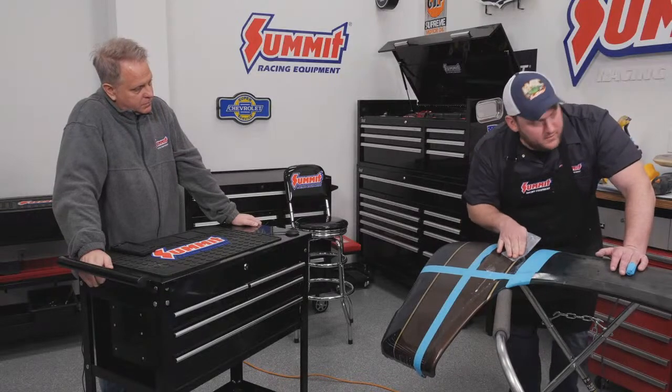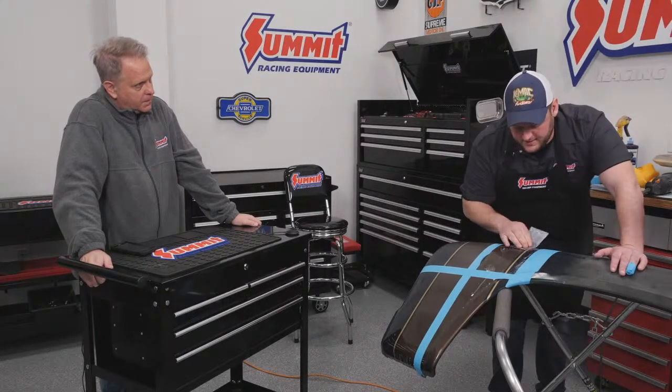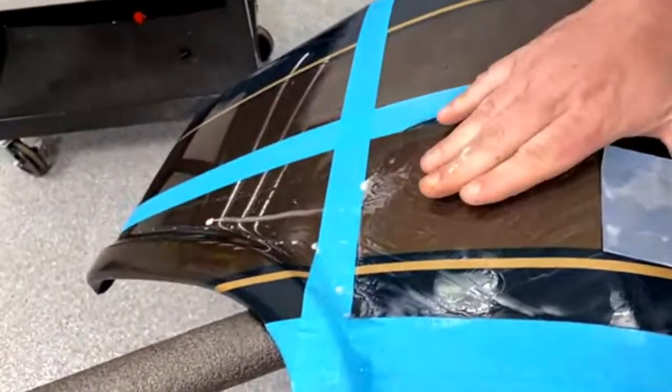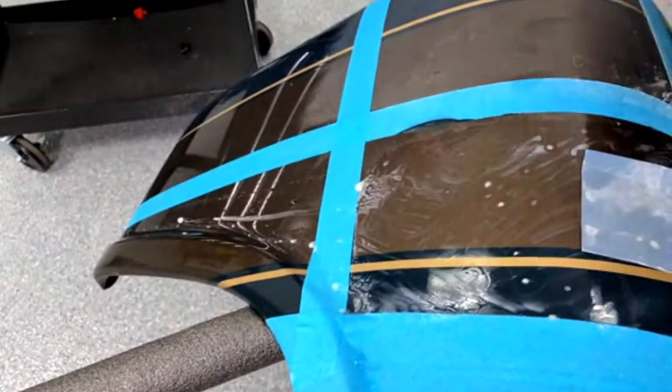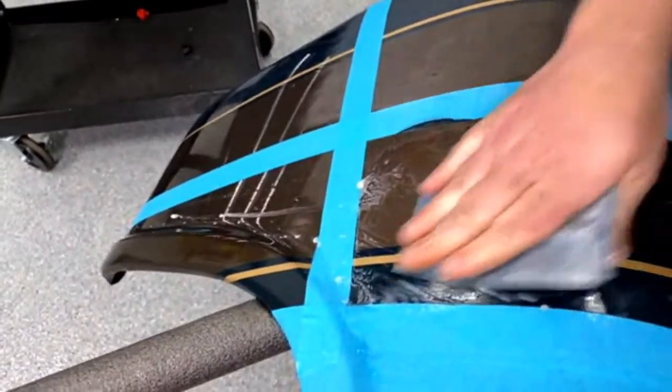If you look at this, you want to come over here, Patrick. You can see the white kind of residue coming off. That's clear coat. If you see green, gold, or brown, that's bad. Immediately stop, because you're going to end up having to probably re-clear it.